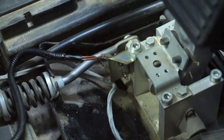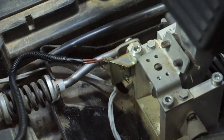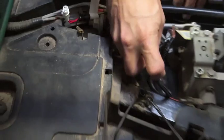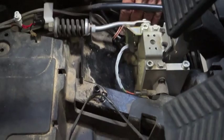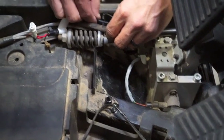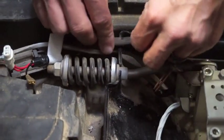Go ahead on the opposite side and do the same thing. Make sure these are tight. Everything is tightened up and you want to check: it's right in line with where it should be, no issues. Once you have that done, route this down and around, going underneath. There's a gray wire here for the sensor on your brake — follow that sensor wire right around. There's a little notch in your pedal group box — slide it right through that notch.